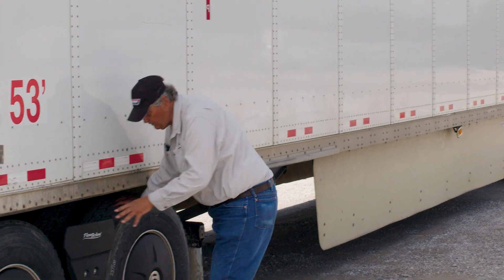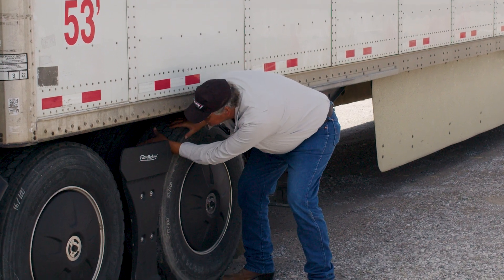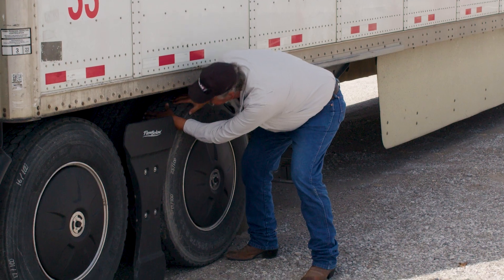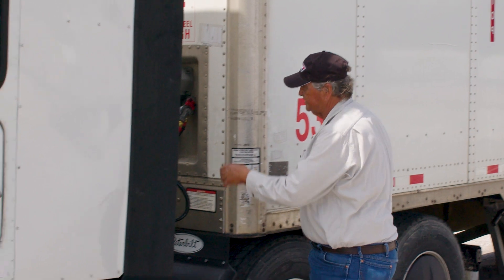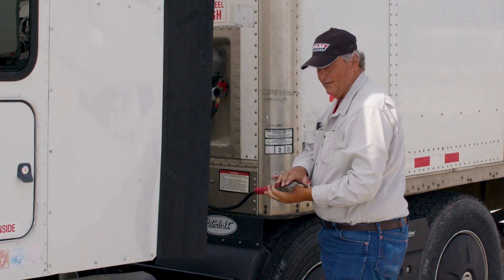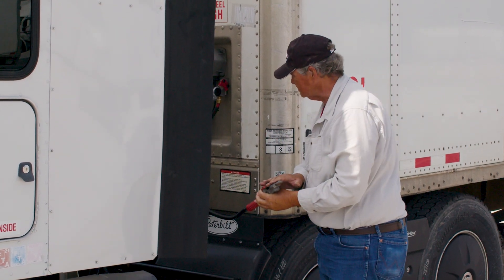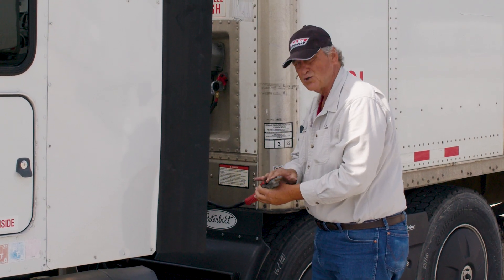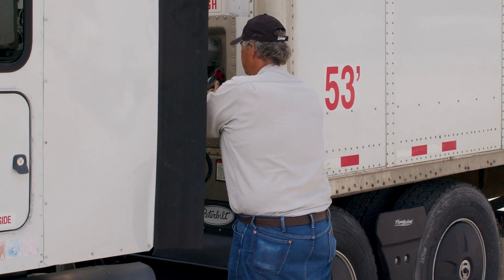Check this one the same as you would the other. Back spring hangers, your airbags, your shock absorbers. These airlines also have what's known as grommets inside of them — that's what keeps the system sealed and keeps the air from leaking down. Make sure they're there, they're intact, they're not cut, not torn, and they fit securely on the glad hand connector.